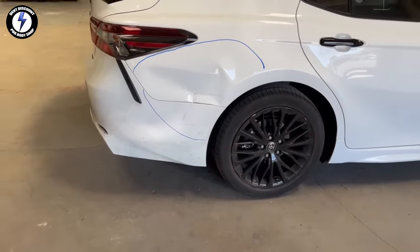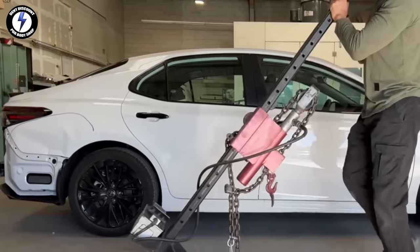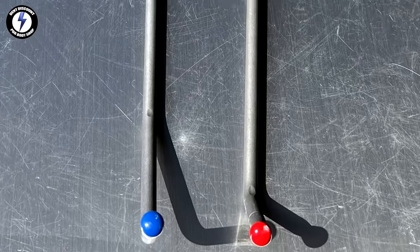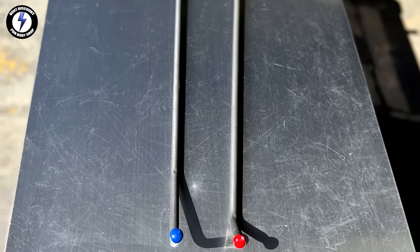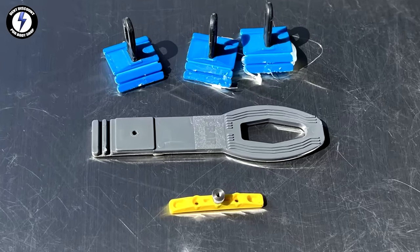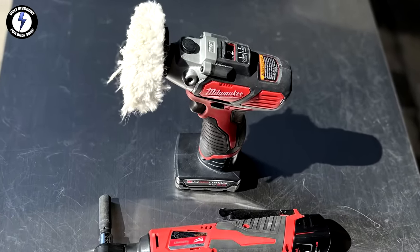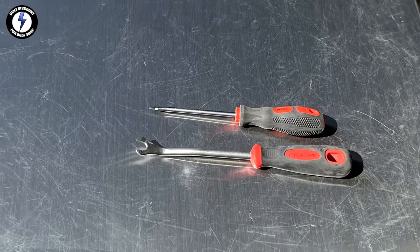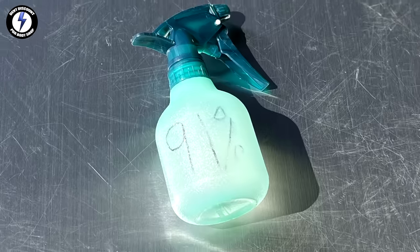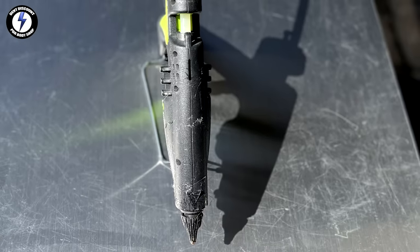Let's go over the list of tools I'll be using in this repair. I'll be using two floor pullers to remove the dent, and I'll be warming up the damage with a torch. You may recognize these PDR rods from the last video. These tabs are great for pulling collision damage. I'll also be using a battery-powered socket and polisher by Milwaukee, hand tools for removing panels, leather and steel knockdowns, alcohol for cleaning the panel, hammers, and a special collision glue.